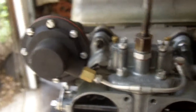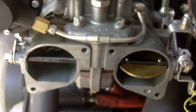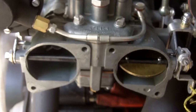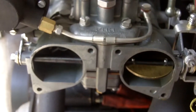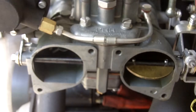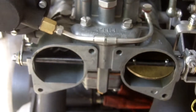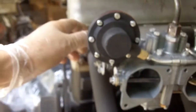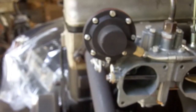Not much you can do about that without the machine work, so the idle will vary a little bit. Right now we're back to 1,100. So we picked up — now we're about 1,200 or 1,300. Not much you can do about that; you must just come out each time and push on your counterweight. I'll try to make some more adjustments, but we're doing pretty good so far.